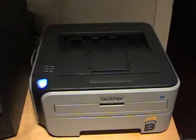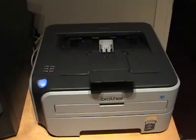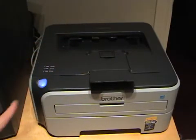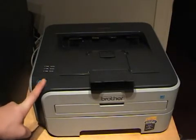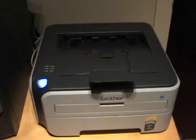It's got a compact design — not everything bulging out. This folds up when you don't want it, and when you want it, it's right there. And this is, I guess, for like envelopes and stuff. And this is for the standard paper, so you can lift it up easily. Now, I'm going to show you the wireless features. I hold this button down for ten seconds, wait until it starts to blink. There we go — it's going to print the wireless setup sheet, which gives you all the data that you need when you're configuring or have some issues with your wireless. You have all the settings right there, which is nice to know.